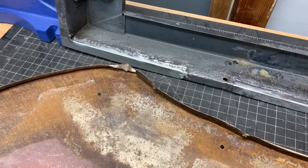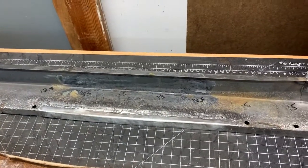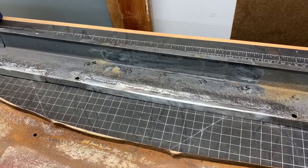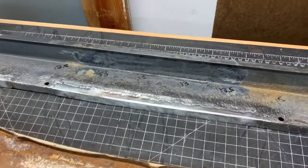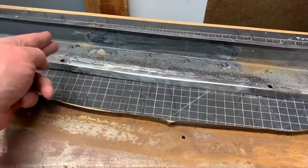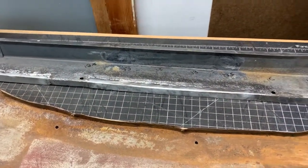I got them fitted up just fine. You can see here I've just sort of ground off just the top of that bead. I'm pretty sure now that I've got that down enough that I'd be able to take it to a point where you'd barely be able to see it — there's still some pitted metal next to good metal, so it wouldn't be perfect. But clearly that's something I've gotten a knack back for. You'll see I've included some numbers here for the width of that flange in millimeters, so I need to go back and trim it up to what it needs to be for the door.